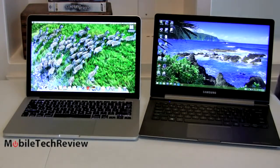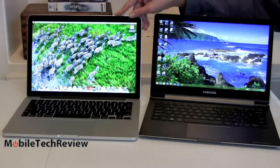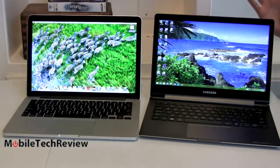Both have webcams up top. I give a slight edge to Apple for their larger pixels, giving a little better, lighter video. Both have extremely high resolution displays — Apple kind of started that trend with their Retina displays. The MacBook Pro has a 2560x1600 pixel glossy display at 320 nits of brightness. Samsung also has a glossy display and decided to one-up Apple with a 3200x1800 pixel display — 275 PPI — so we're getting to the point where it's just a little bit psycho.